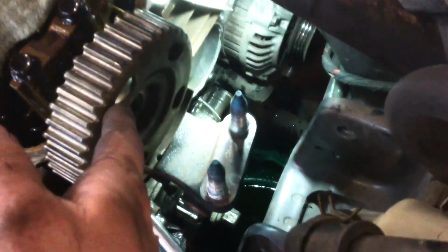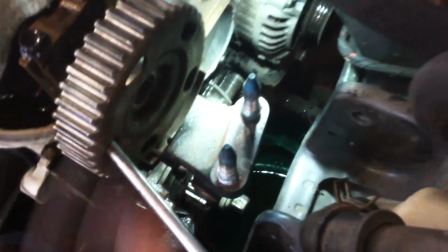So if you want to take that plastic off, you know, take this off, and I'm going to do the seal, as I maybe mentioned. 12 millimeter bolt here. You can hold this still with a screwdriver through one of the holes. Break it loose to the left. Take that off. You can slide this off. There's my bolt. And it's got 2 10 millimeter bolts. One's down there, one there, and this will come off. Make it easier to get that water pump in, maybe easier to clean it too a little bit. So with a little more time, make things a little easier, maybe.